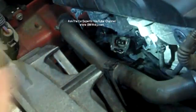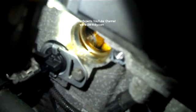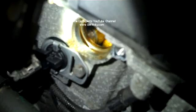Okay, now I'm going to install the intake. Before I install the intake, I'm not sure how well you can see that, but that right there, that shiny silver part, is the solenoid. You see how it goes through the front timing area and pushes right into another opening. Now I'm going to go down here, see if you can see inside. Right, you can see that that front part's actually open. That's where the solenoid sits, and it has to push into that other hole right there. You want to make sure that you seat them fully, and as you can see, this one doesn't stick out at all. It's flush basically with the front of the cylinder head.